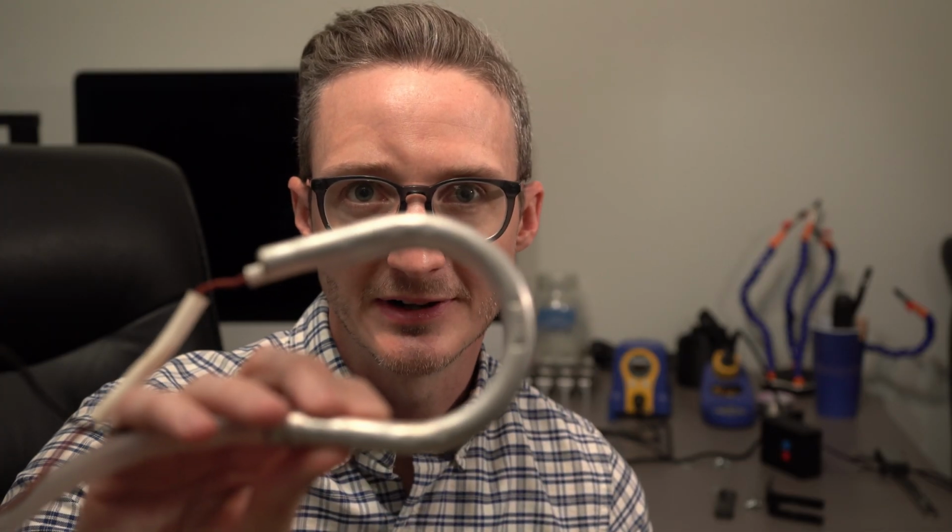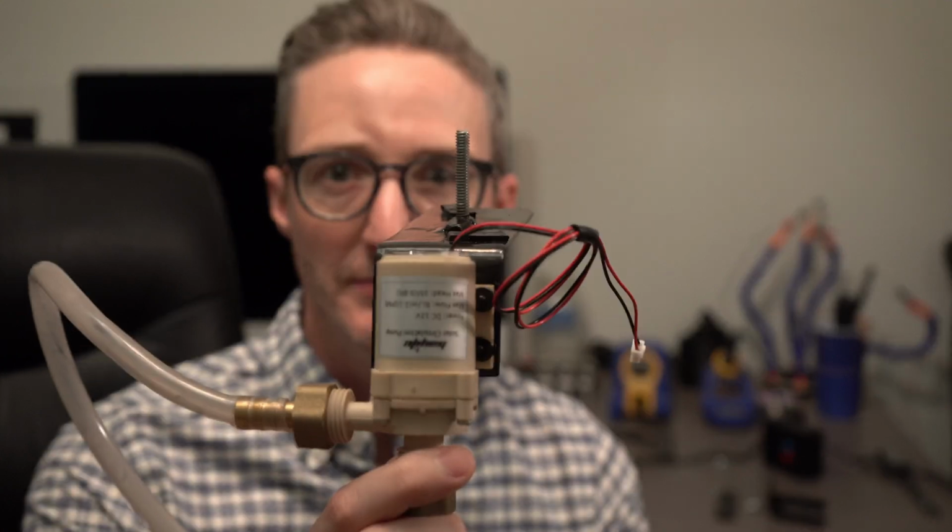While we wait on these steaks to finish, I want to show you the steps that it took to bring the coffee machine parts into what is now the sous vide machine. And that is right over here. The first part from the coffee maker is the heating element. So I did have to buy one part. I had to buy this pump. I got it on Amazon. It was $20, and I needed a pump that could handle pumping hot water.